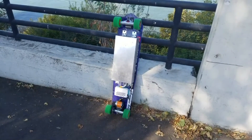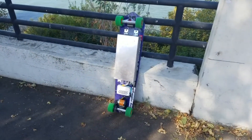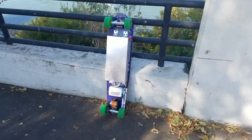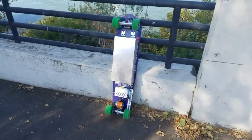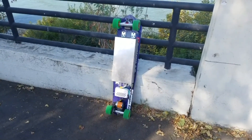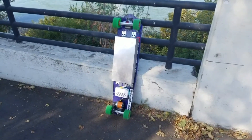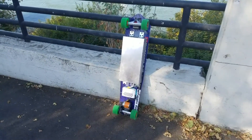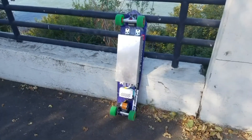There are six hoverboard batteries inside that aluminum box with six BMS's — a total of 27 amp-hours at 36 volts. It tops out around 20 miles per hour because of the belt setup, but I don't want to go fast. I want to use energy at a slow pace and go for long distance. Let's go take it for a ride and see how far it goes.